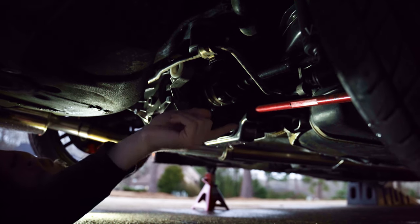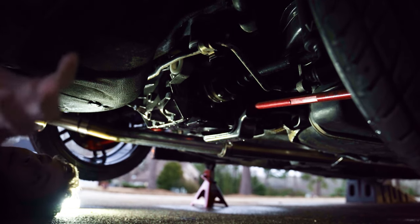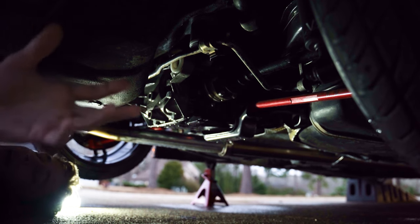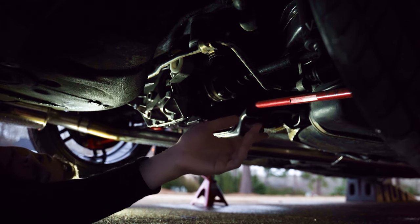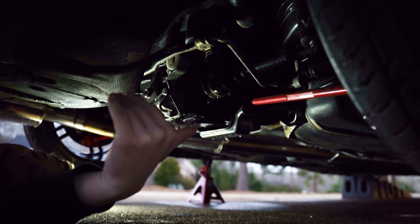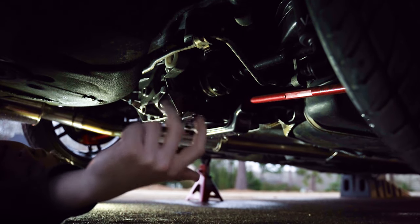The trailing arms. So this is a huge thing, right? A lot of people obviously know that the rear trailing arm bushing problems on E36s is serious. So the answer is never solid polyurethane for a trailing arm bushing. Obviously, you also should know that as the trailing arm tilts, if you have a solid polyurethane bushing there, if you add camber, that bushing is going to bind because it can't tilt.